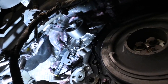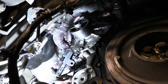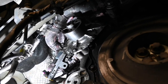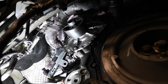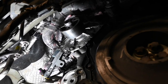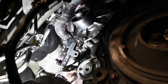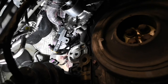There is the new water pump. Unfortunately, looking at the manufacturer specifications and auto data, there are actually no tightening torques listed for the water pump. Normally for water pumps, they're not much at all — normally around 10 to 15 Newton metres at most. Since I don't have that information, I've done them all up finger tight and then given them a little pull around to just nip them up. I'm now going to take the opportunity to clean up the dry coolant debris, especially on those electrical connectors, before connecting them, then get the tensioner, idler, and drive belt back on.